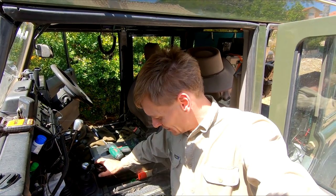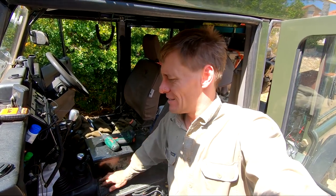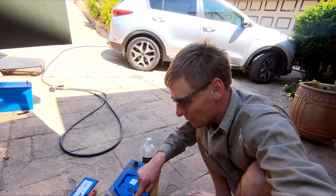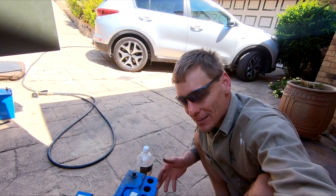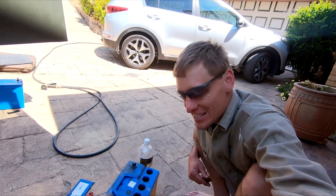The lithium is in and two of the circuit breakers are in position. I'll throw the starter battery back in, and when the rest of the wires arrive in the mail next week, I'll extend the DC-to-DC charger cables through to here — then the wiring is pretty much done and it'll be almost ready to travel again. While it's out, I'll have a quick look at the starter battery as some cells need a top-up. It's interesting how quickly the water evaporates in the outback — this is probably the second time I've topped it up this year.